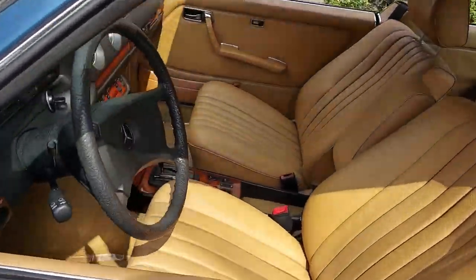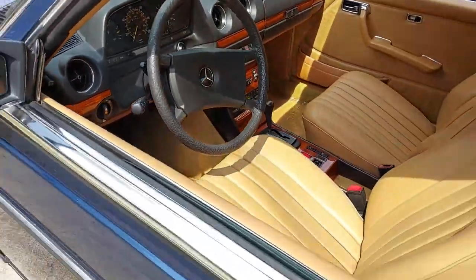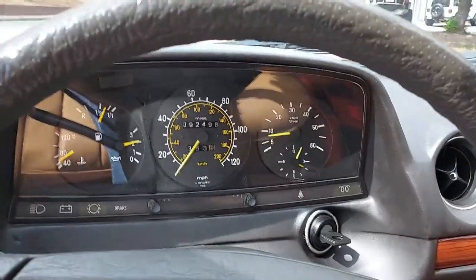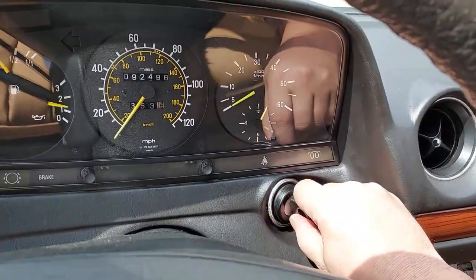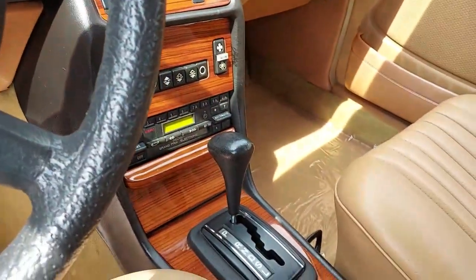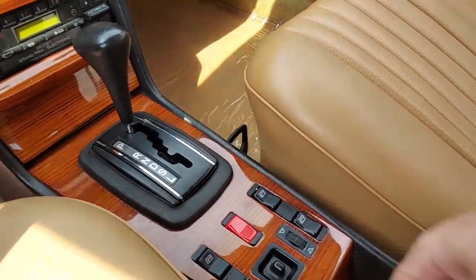Let's go ahead and turn this guy off. So a healthy vacuum system, the car will shut off within 2 seconds. Ready? 1,000. All right, here we go. Now we have 1, 2, 3 keys for the car.